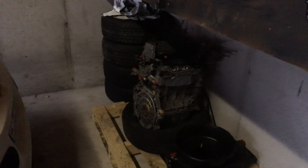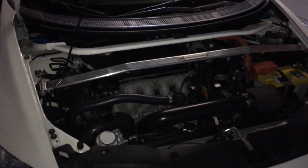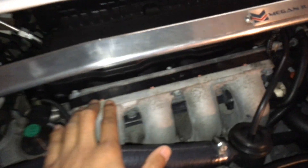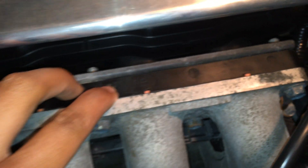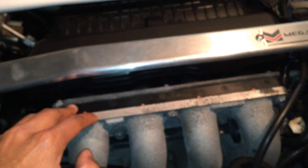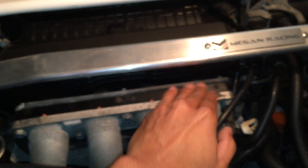A little note for those of you doing the GE8 intake manifold swap: make sure when you swap the intake manifold, if you buy one, that it says RB1. That's technically the spoon intake manifold, but from a Honda Fit. You don't want to mix it with the older generation intake chamber because that's more restrictive from what I've read or heard. So when you do that swap, make sure you do that.